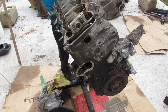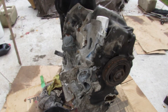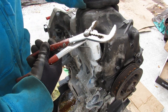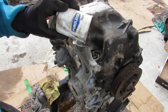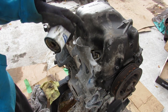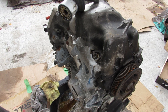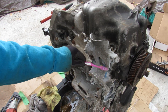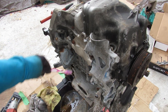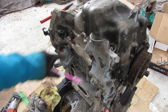I'm going to turn the engine over. I'll use my oil filter removal tool to remove the oil filter. They've got a Purolator filter on there so it was probably maintained by a shop using cheap parts. The oil filter housing is located right on the bottom with the drain plug just over here. On the side of the engine we have the AC compressor bracket, alternator bracket, and exhaust manifold mounts. I'm going to remove all these accessories so we can get access to the oil pan.